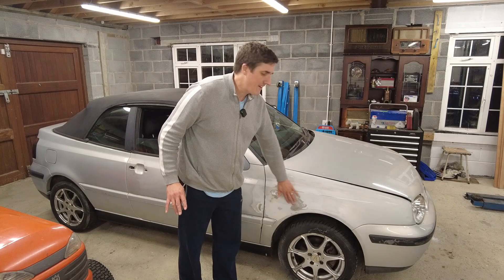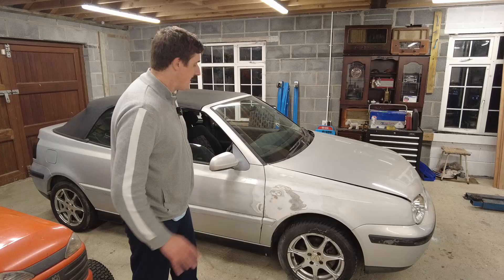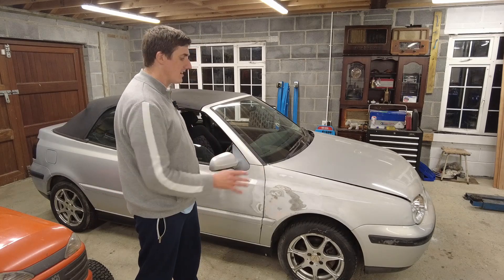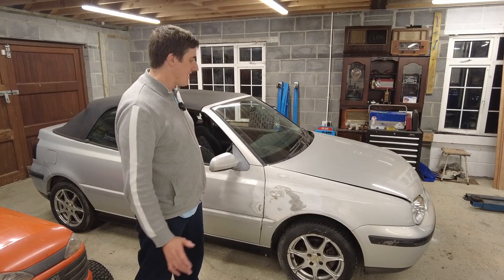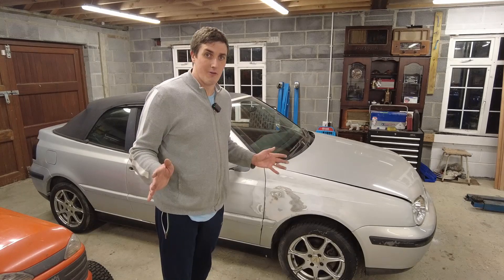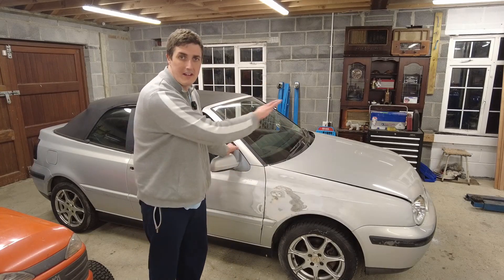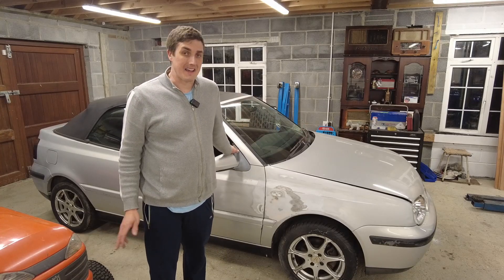You'll see I've actually started rubbing back here, and there were some dodgy-looking repairs done in the past. The great thing about the Rust-Oleum Combi Colour I'm going to be using is it's going to hide all that, but you still have to do the surface prep and get it smooth. It's not going to hide imperfections in the contours of the car. I'm figuring this out as I go, so let's start unbuttoning the trim and working right around the car, front to back, taking off anything that's easy and masking up anything that's not.